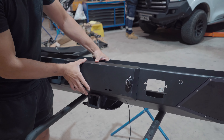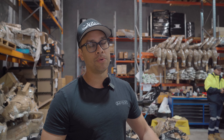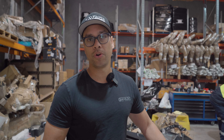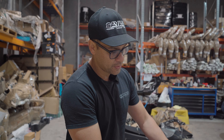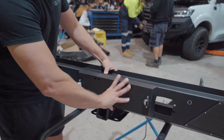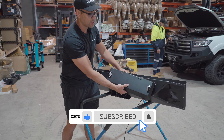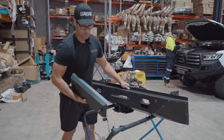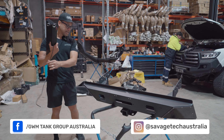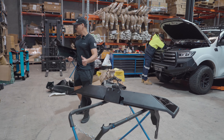The number plate mounts on there. My original version had a winch cradle on it, but it was too much hassle to install and I decided to remove it as an option. However, the cutout is still behind there for a winch cradle if needed. You've got all your parking sensors — two rear parking sensors where you knock out the factory holders and they go straight in. So you've got parking sensors, blind spot monitoring, three-ton tow capacity, all compliant and tested in Australia, plus a nice rear bar that improves your departure angle.